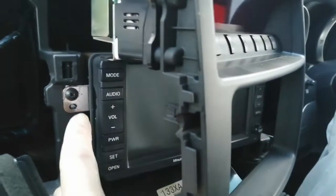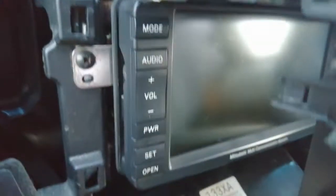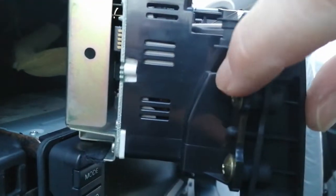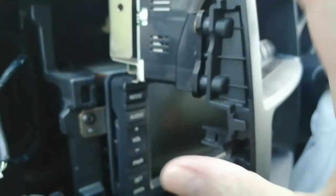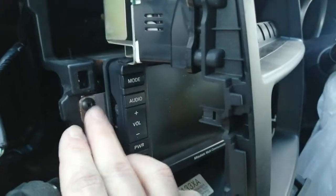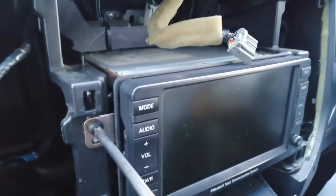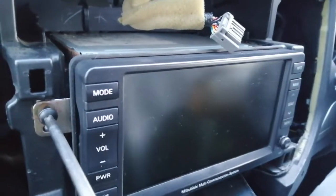That gives access to the main screws that hold the radio in — just here, Phillips screws, one each side to take out. Also this upper unit will need to be removed and put onto your new fascia — it's held in with four screws. Move it out of the way so we can unscrew the stereo. The top unit is removed and it's got a little press plug for the wiring — just press the button down and pull the plug out so you can remove the whole assembly.